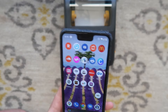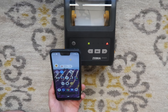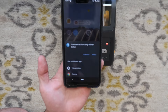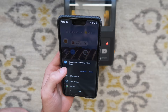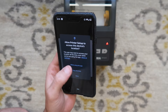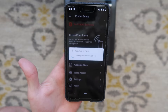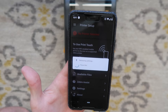That's how I'm going to be connecting to the printer. There's this little phone icon with a wireless signal — I'm going to tap my phone where the NFC is, which on the Google Pixel is right underneath the fingerprint sensor. I'm going to tap and move it around a little bit until I feel the vibration and a prompt pops up saying 'complete action using printer setup.' Pick the Zebra Printer Setup Utilities, hit just once, and it's going to open that app. Allow it to use location. Now it says it's looking for the printer from tap-to-pair, connecting via Bluetooth and NFC.